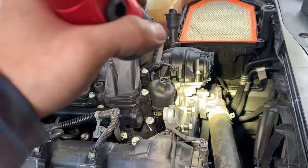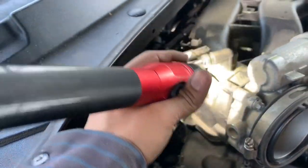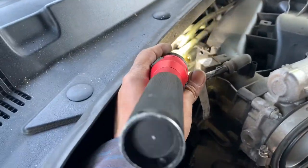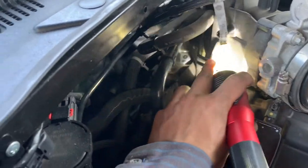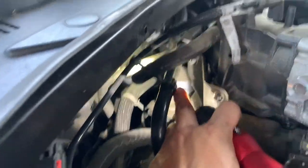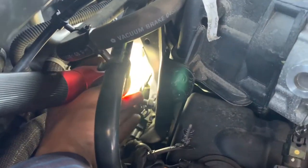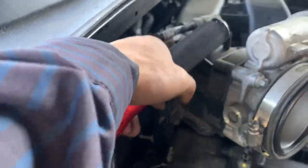To start off, I took out the air tube and the air box on top. Disconnect whatever hose is connected to the intake manifold - the one inside. I have two 10 millimeter bolts right here, this one and that one in the back. You're gonna have to remove this 13 millimeter right here to get some room to move this bracket out of the way.